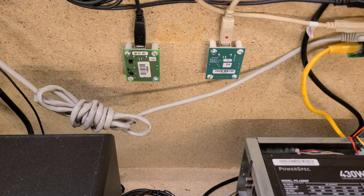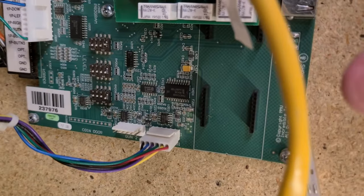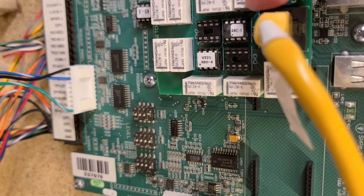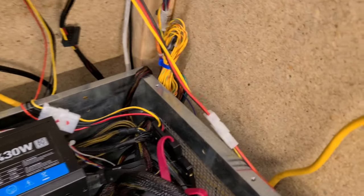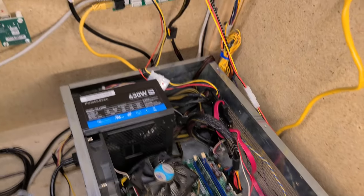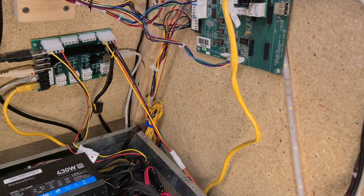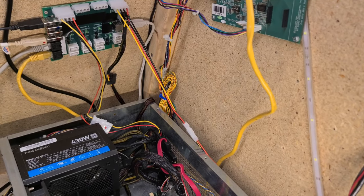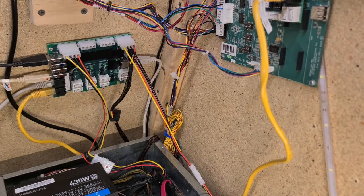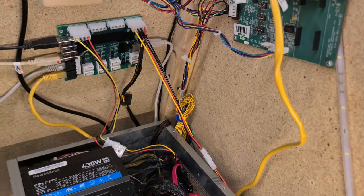The CID for the Arcade Collection is hooked up, assigned to port 24 on the Magic Switcher. The security chip for Arcade is in channel 4 — make sure the orientation of the chip is facing the right direction, ask me how I know. The SSD hard drive is plugged in. For specs, you need Golden Tee Live 2013 or newer, which should have around a gig of RAM. I'm also dropping my affiliate link in the description — it'll save you $50 on the Magic Switcher.